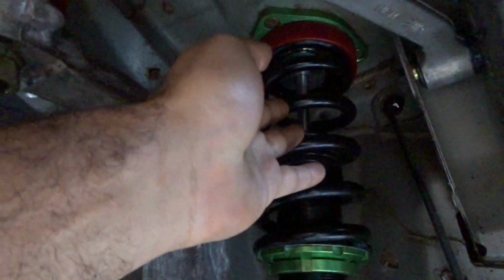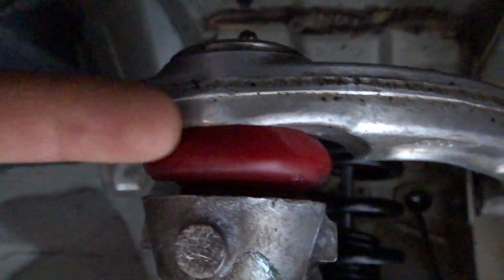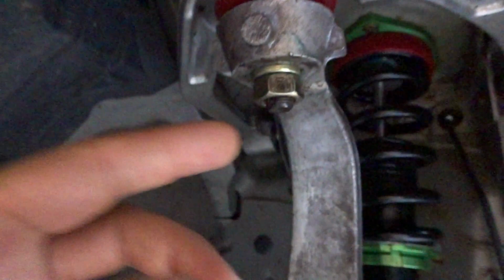Well, on today's episode, we're actually going to dive into the 350Z, and finally, after finishing the suspension, all the old bushings are popped out, replaced by Energy Suspension, as you saw in my previous videos. Let's take a look. We have the coilovers over here with the coil spring isolator, but this is the coilover. We have the Energy Suspension boots. I installed some Zerk fittings on top, that way I could definitely grease up the ball joint itself. Put some lock nut washers, upgraded the new nuts, practically re-threaded them as well because everything was so rusted.